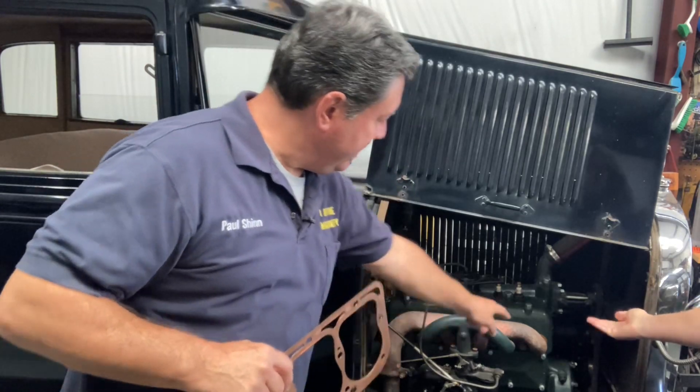He's asking for advice and whether it's time to pull the engine and check the head. I'd say next is probably the head gasket — you don't need to pull the whole engine, but it's definitely time to pull the head. Check for cracks; somehow hot combustion gases are probably getting into the coolant. You could start by re-torquing the head to see if it just came loose — sometimes that'll do it right there. Otherwise, yeah, it's time to pull the head.